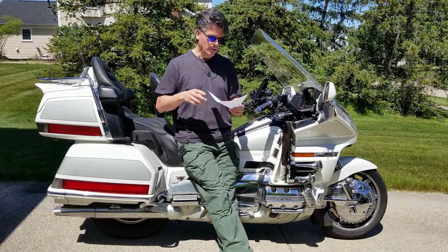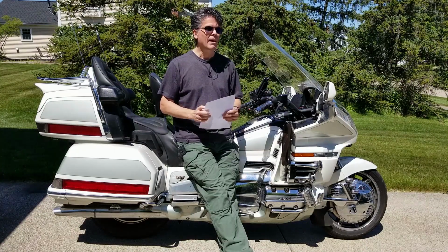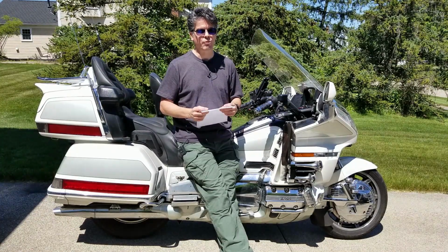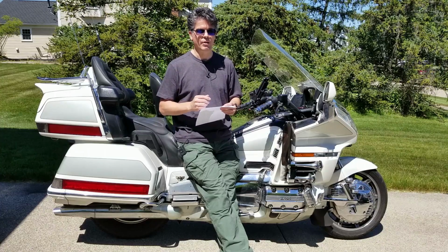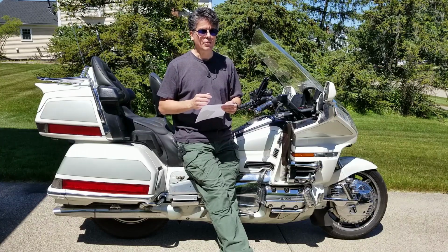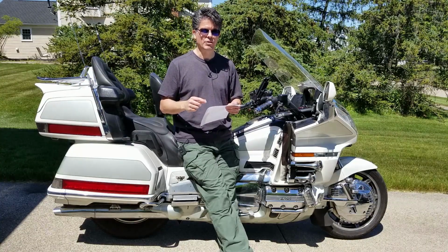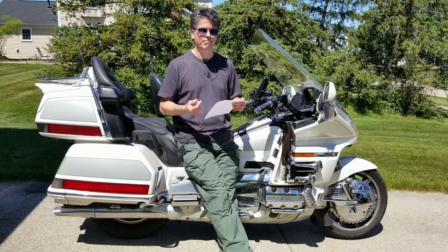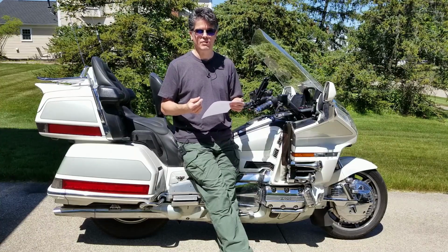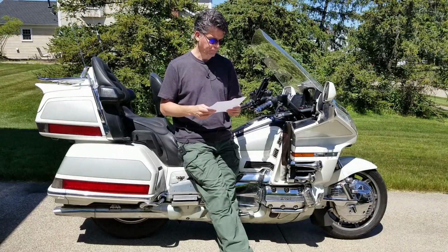That said, you said it sat for a year and ran before that. You might want to also have a look at the timing belts before you try to start it up. If the timing belts haven't been changed in a while and it sat for a year, it's definitely time to do those belts. If a timing belt fails and you try to start the engine, which it very well could do if it sat for a while, your valves are going to crash into your pistons and basically the engine is scrap. So hopefully that helps you.